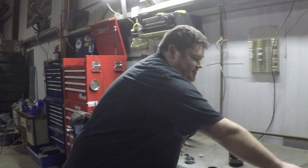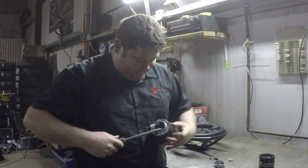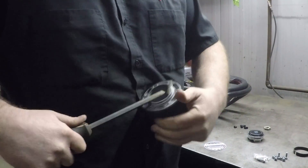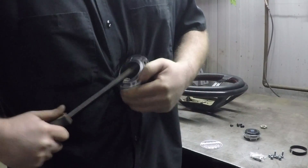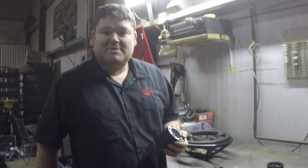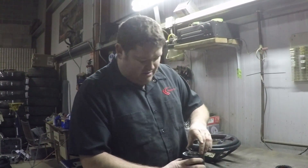Removing the inner ring is quite simple. Just take a big screwdriver, put it in place, and press around until the ring comes all the way out. Now the horn will be able to go down inside and life is good.